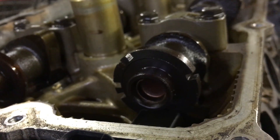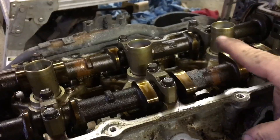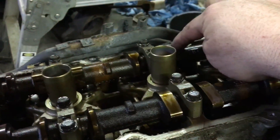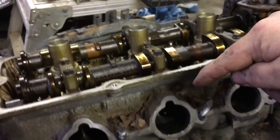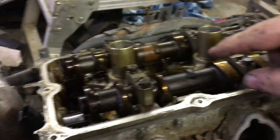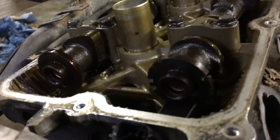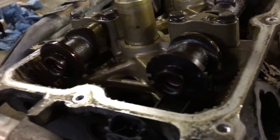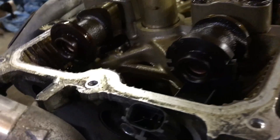As you might be able to notice, there are some notches here in the end of this camshaft — that's what you're looking at. You're looking at the end of the intake camshaft. That's your intake side, that's your exhaust side. I know that because this is the intake valley and the intake comes in on this side. So as this intake camshaft spins, it causes these gaps —